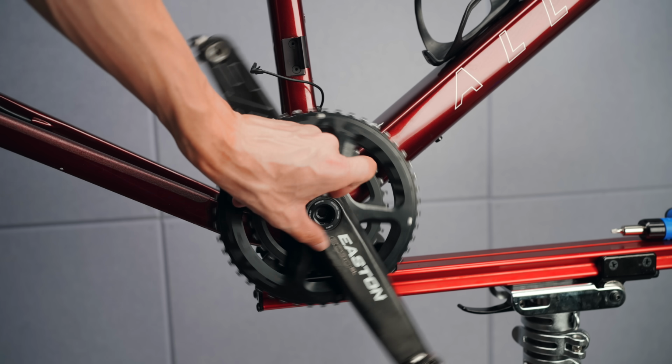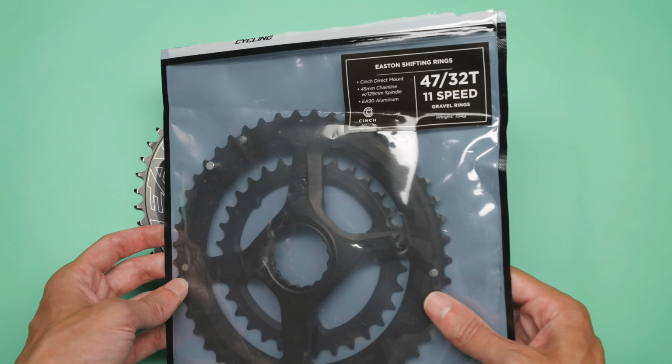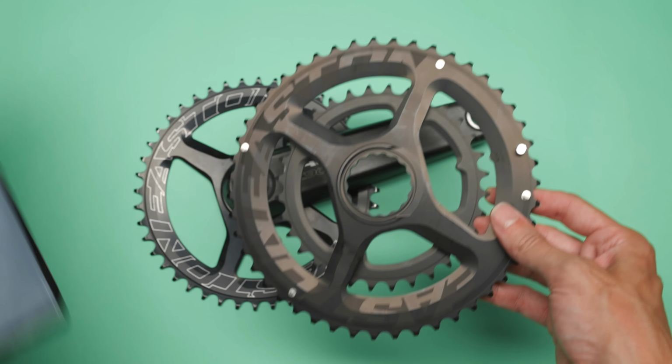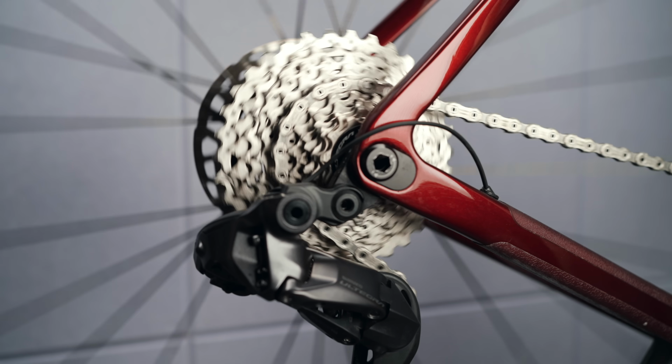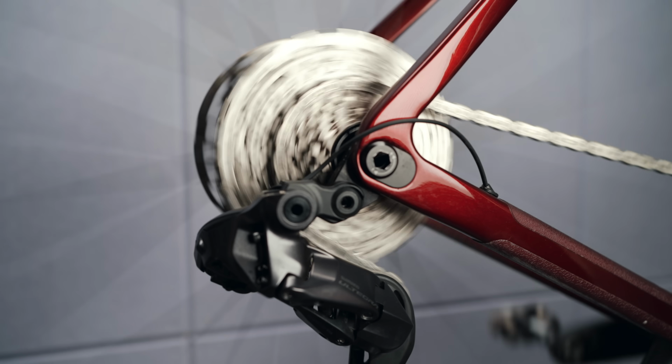Now, as I mentioned, I wasn't really planning on going full road gearing on the Echo, and I already had a subcompact chainring setup for my Easton EC90 SL crank that I got when I tried to do this on the Amonda a while ago, which I eventually gave up on. I will combine that subcompact with an 11-34 Ultegra cassette for that sub 1:1 gear ratio.